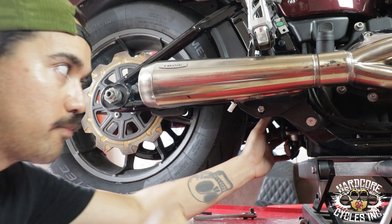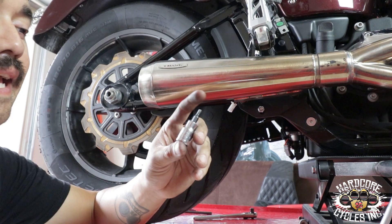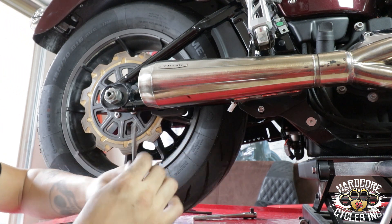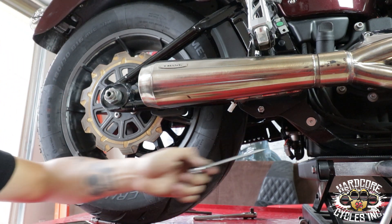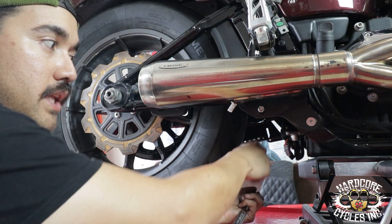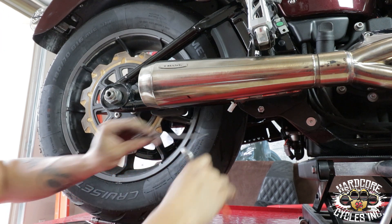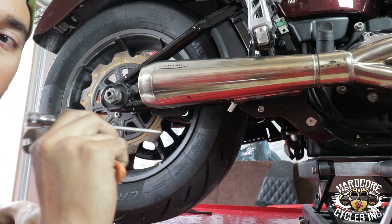When it comes to securing the compressor onto the back of your transmission, first thread the bolts in by hand using a shorter 5/32 Allen socket so you can get the screws set. The next easiest way is with a ball Allen. On the clutch-side bolt, come at it from the brake side so you can get in at an angle and tighten it. If you can't get a good purchase, use a smaller wrench or a crescent — it's a weird angle, but stay patient and get a good purchase on those screws so you don't strip them. A ball Allen went a long way on this one.